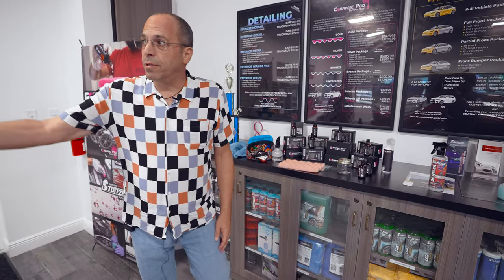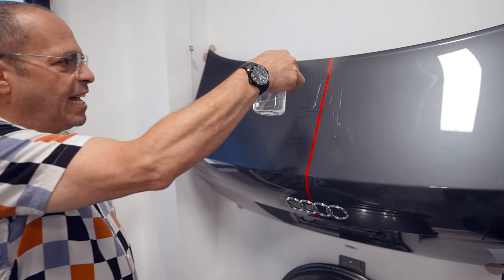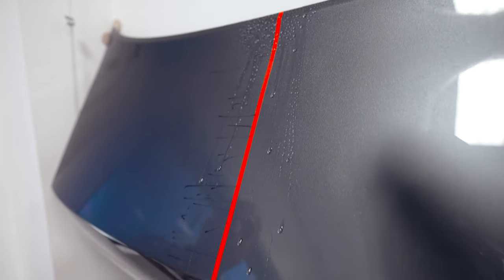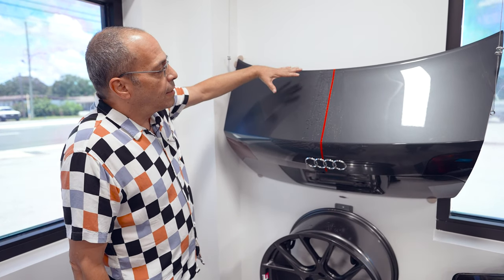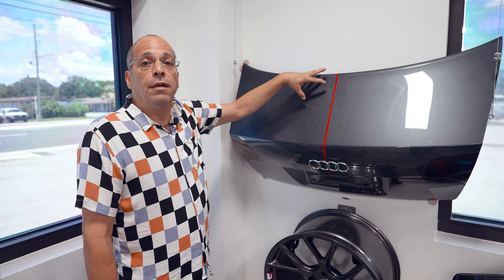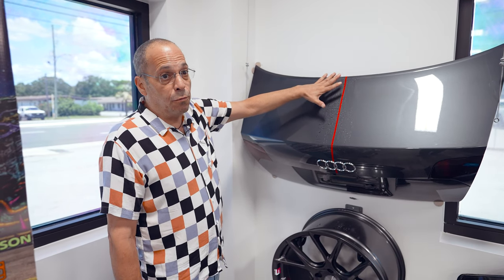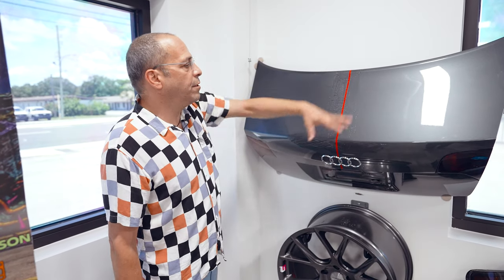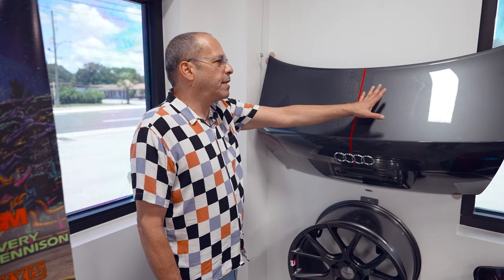What we have on our board over here — I just have a water bottle and I'm going to spray it on the line. You can see they're both running, but look at how many more drops are happening on the coated side. The water kind of sticks on the non-coated surface, and that means the water trapped whatever dirt and debris it landed on — right there it's going to stay. You're going to get water marks that are really difficult to get out. As this stuff runs down your hood or surfaces, it's much less sticky, much less stuff up there, so much less water beading to clean off. Because it's much slipperier, it doesn't penetrate the surface quite as deep and it's much easier to get off. If this took you two hours to clean, this will take you about five minutes.